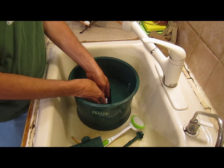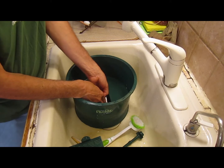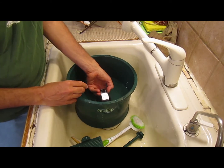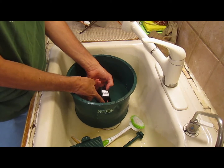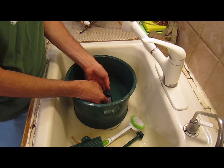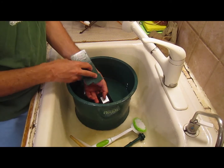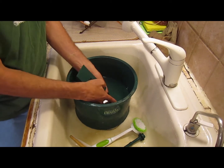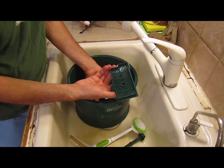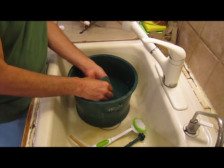This motor is on rubber feet, so the rubber feet come up. Notice I'm holding down the tail where the wires are because I don't want to yank up these wires — it wouldn't be a good idea to yank on those wires or hurt it. Now the motor is in my hands, and once it's in my hands, I want to line up this edge with this edge and move that hole to be on top of this hole.